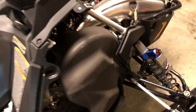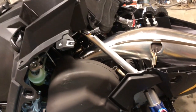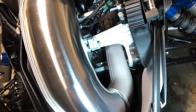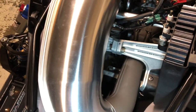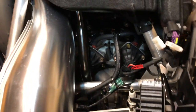It's really nice. So what I was saying earlier is the steering post, the Ski-Doos. I can't speak about the Gen 4s, but I believe it was the XPs. They had a straight post that connected directly to kind of like the steering frog, like an ATV, and then that went to both the tie rods. This is a direct connection. And from talking to one of my buddies at the Iron Dog, who's sponsored by Ski-Doo, that's actually a patent that they have. So it's probably why Polaris had to go to the two-piece steering post on the Pro-Ride chassis.